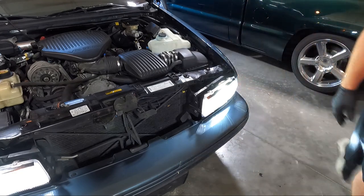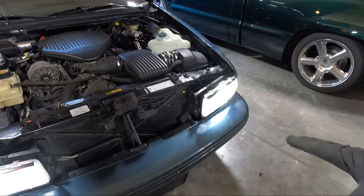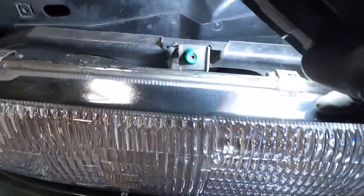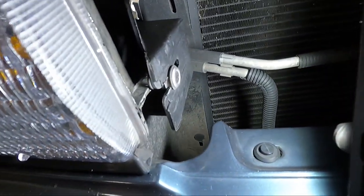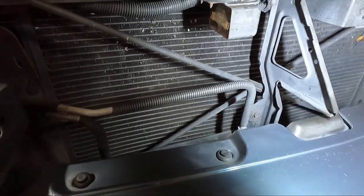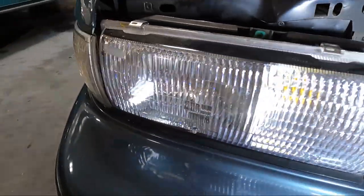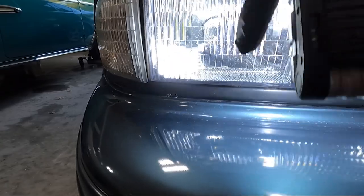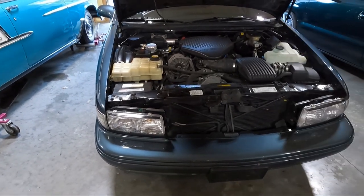I may do some aiming. I'll show you guys the two aiming points — let me show you exactly where we're going to be adjusting because when I go to do it it'll be too dark to show you. Right here, GM loves to use Torx on these. That top one with the green surround is one, and then you have this guy on the side you can tighten or loosen as well — you only have access from this side, and that's on both. Make sure your light is straight up and down. At this point we're all finished up.